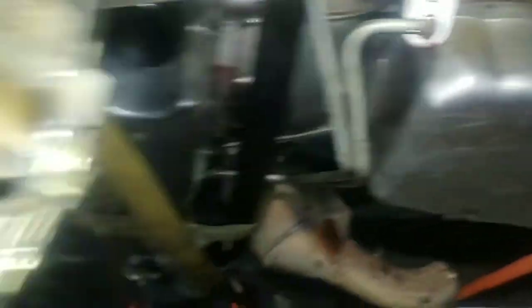What you all missed is I removed the exhaust, I removed the center piece right there — the drive shaft — and disconnected the exhaust. Also, I pulled off the bumper and the bumper support so I could remove the oil cooler and get these lines emptied, pulled them off the radiator. Also, I disconnected the oil cooler from the transmission, and began running the strap to support the front side of it.